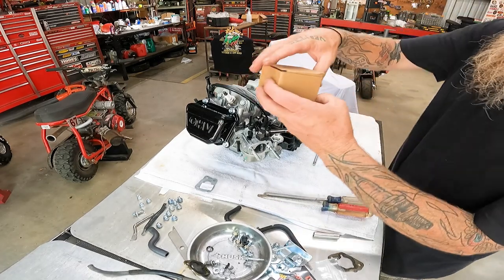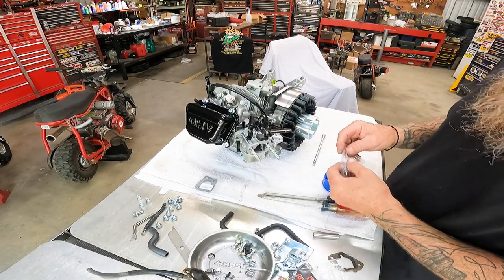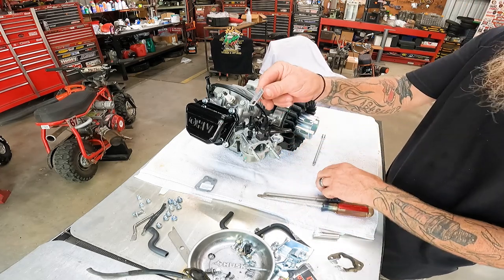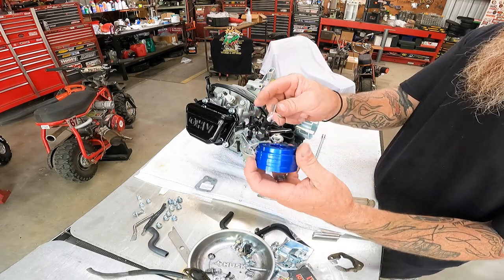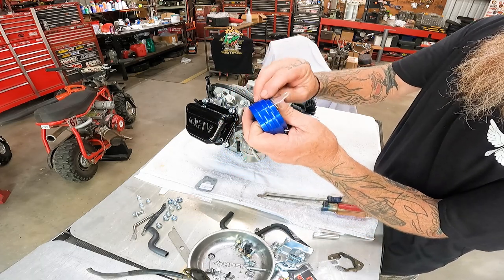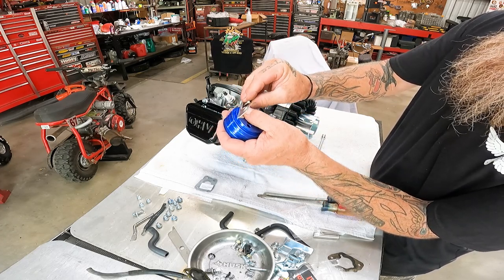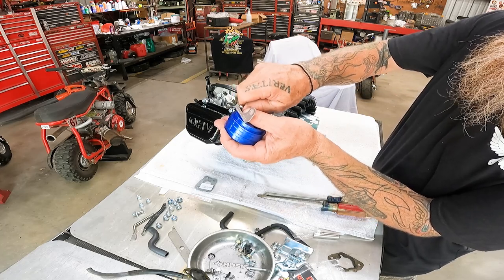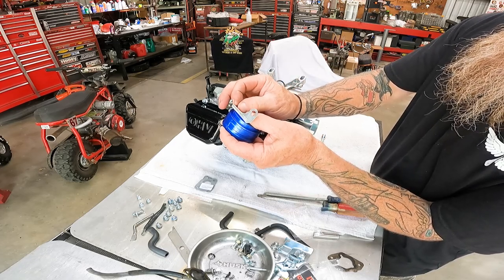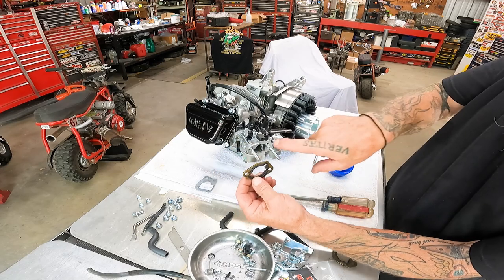Now we'll come over to the Stage 1 box kit. I need to go find where I stashed the choke rubber. In the back here you've got your little brace that holds your choke down. I like to start the bolt first — it's going to sit just like so. I think this is an eight or nine millimeter. Get the bolt started just like so. That's how it's going to look. Take your outer gasket — the notch goes up for your vent — and that goes on next.